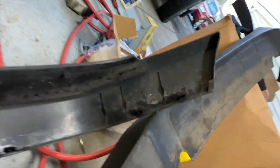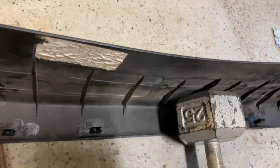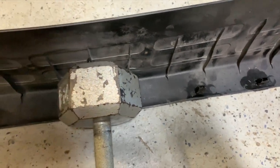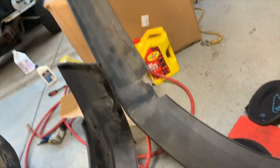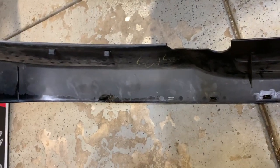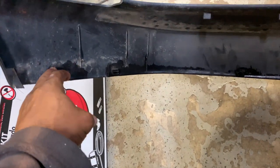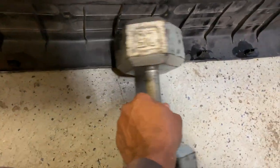Since I managed to save most of these locking tabs or clips from the old bumper, I'm heating the plastic up and using one of my dumbbells to get that warp out of the front. I'm almost there. The new one doesn't have enough tabs, but this one looks better than that one anyway. I'm going to buy some liquid nails and glue the foam inserts on the top and bottom with clear liquid nails — a bead of glue around each one so it won't come out.